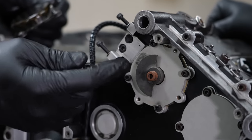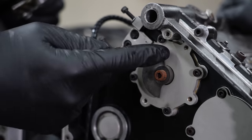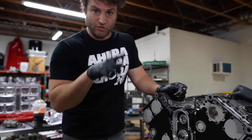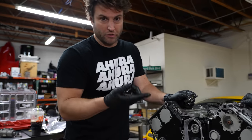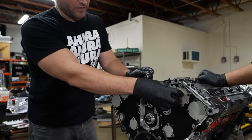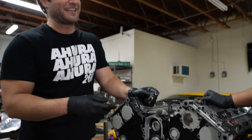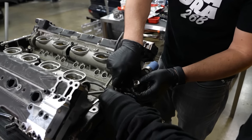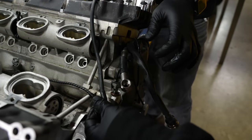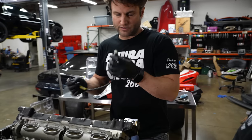What you're basically trying to figure out is which position the motor's in — between the camshaft and the crankshaft, you can tell out of the 720 degrees, which is two full 360s, which of those two you're on. Bill from Lola Champ Car was telling me that you can run it without this sensor but it has to guess, so it can be putting in fuel at the opposite time of when it's supposed to, and you get the nastiest backfire. This is definitely an oil distribution block, and the one off the front would go to the turbo.